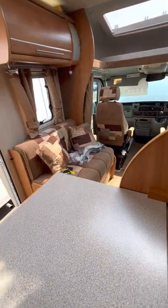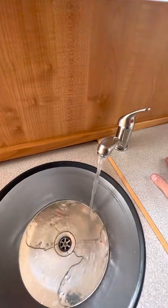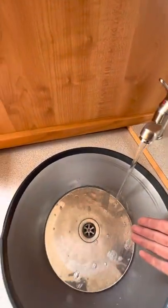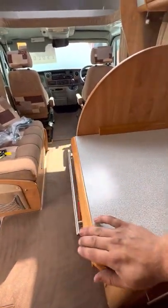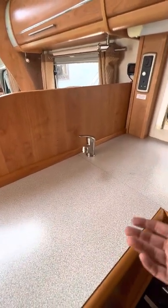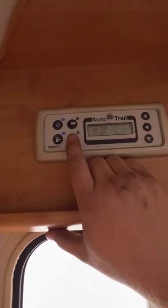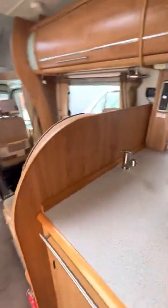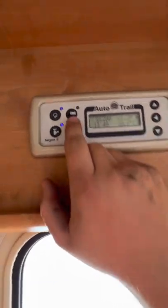The pump won't turn itself off until it's up to pressure — so pull the cold water through, no air in the system, then go around to the hot tap — no air in the system. Once you've done that, that proves the boiler is full of water. Until your boiler is full of water you shouldn't really turn it on — if the boiler is empty you shouldn't be using it. Your ORC switch — I would advise you just turn that on, because that powers up anything that's been added extra. These three switches really are the ones you want to have on if you're going to come in and use the van normally.